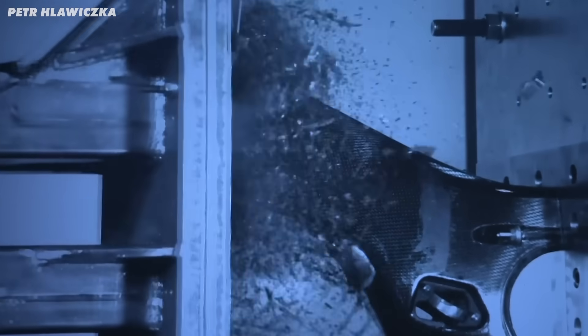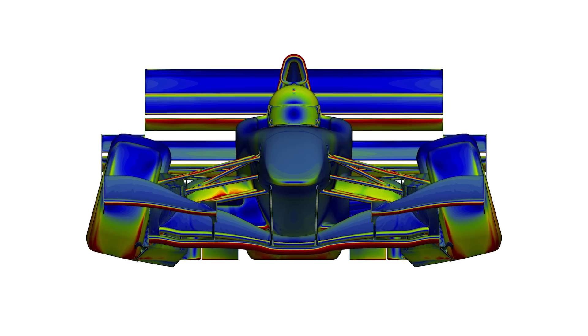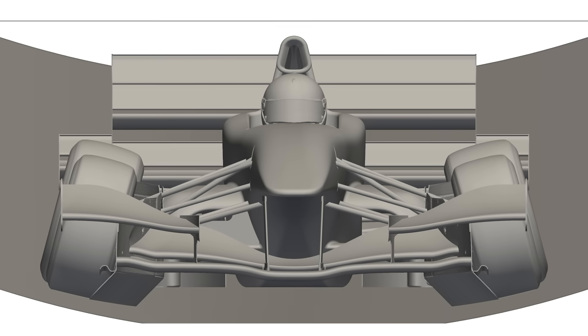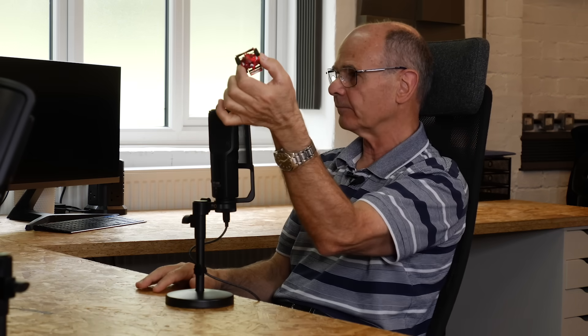Safety is a massive concern but they feel it's covered. Willem has allowed for extra weight for safety components such as crash structures, a halo, and more strength on the roll hoop — because if you start upside down, you've got a bigger chance of ending up upside down. As for the camber: first, to fit the curvature of the tunnel the wheels need to match with more camber, to spread the load across the entire tire. More importantly, to optimize for the worst condition — around 145 degrees — you want maximum tire contact area at that point. That's why the car is redesigned with a much higher camber angle that suits the curvature of the chosen tunnel.